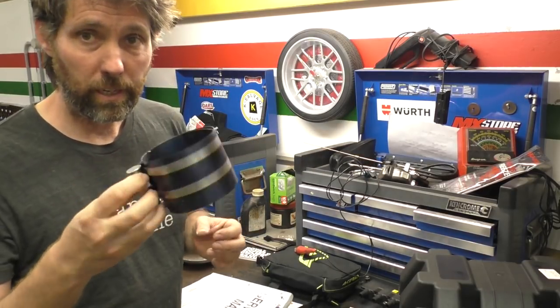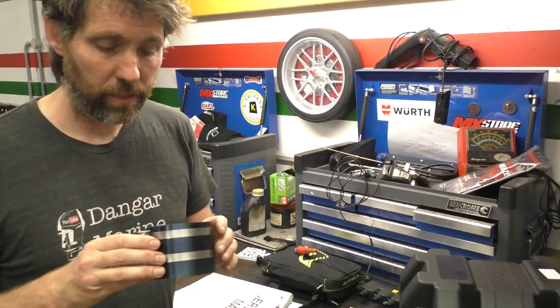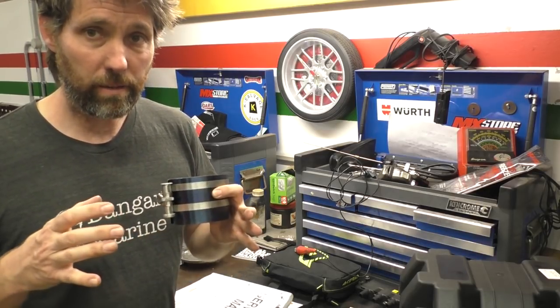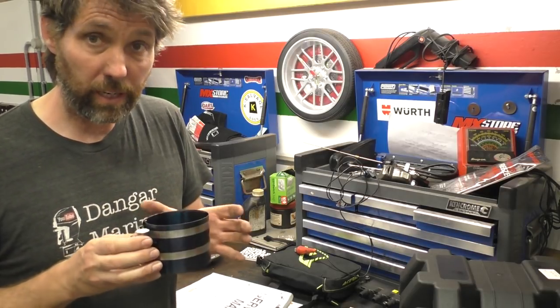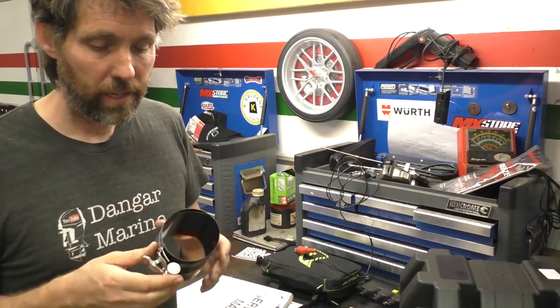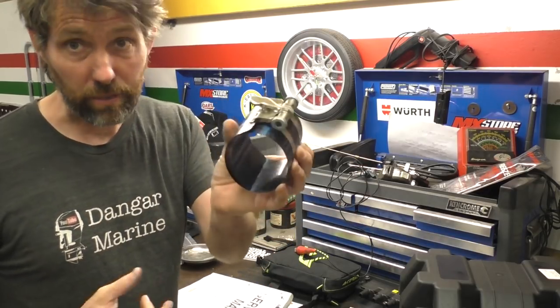This style of ring compressor is disliked by a lot of people — they're very sharp, sort of a bit razor-blade-ish. But the great thing is they work for quite a range of ring sizes. You can get fancier ones where you need specific sizes, but as a cheap option that works on most motors, this style is pretty cost effective.